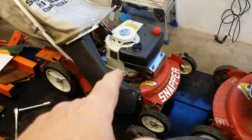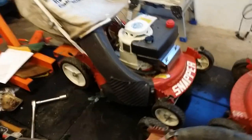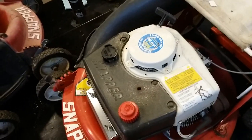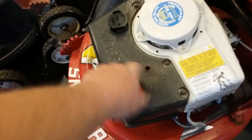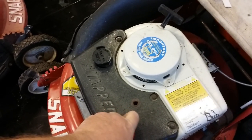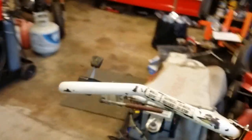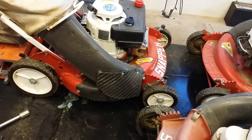This one I picked up at a yard sale a few years ago. It is not a rear drive — it has a Tecumseh engine, not my favorite; I like Briggs or the old Robin Wisconsin engines, which are now Subaru. It's a 4-horsepower. I know I got it running when I got it, and it's bone dry of fuel — my guess is I ran it out purposely. It needs an air filter. Unfortunately, someone cut out the side of the chute so they could side discharge, which is unfortunate since the chutes are really expensive, and somebody put a patch over it.